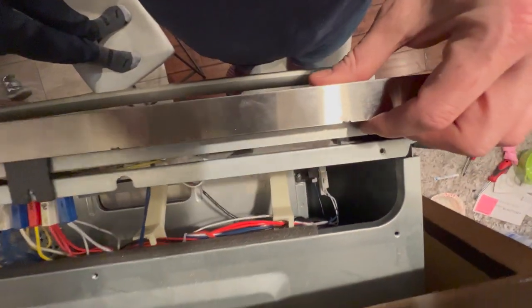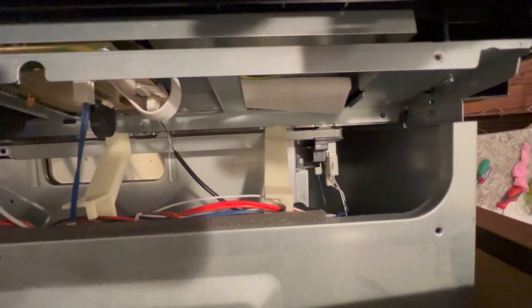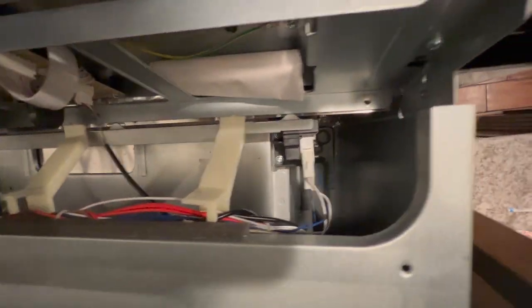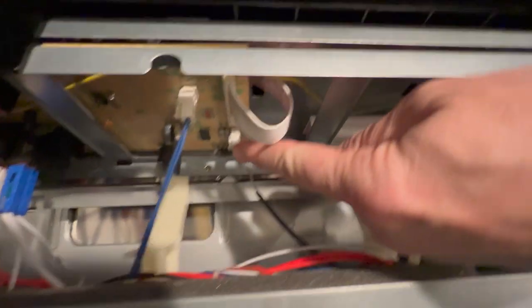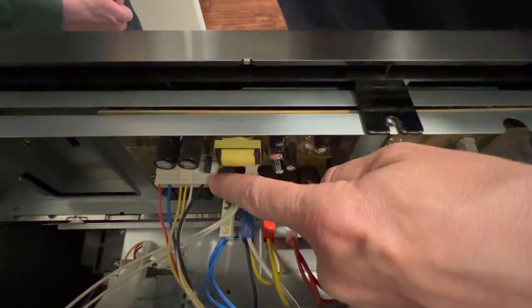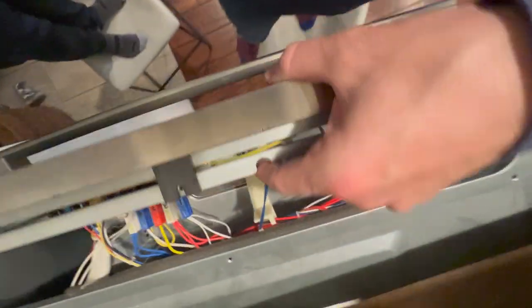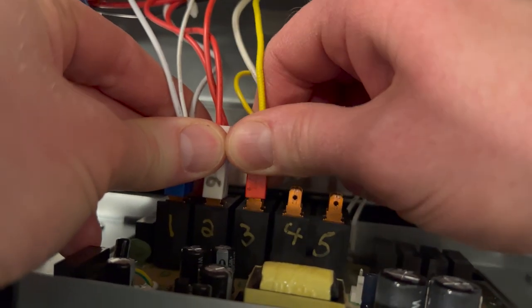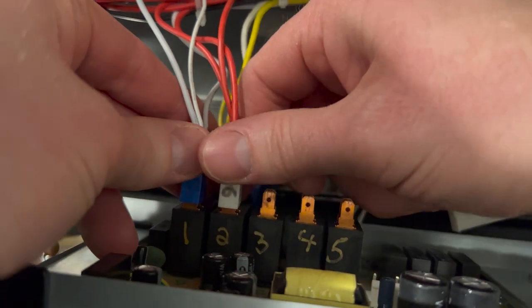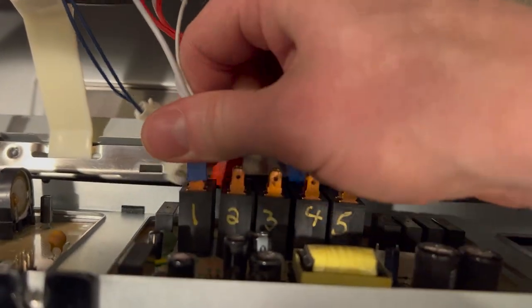If this isn't wobbling or loose yet, you're probably missing a screw so look around. Take very detailed photos and/or video of how everything is plugged in. There's a plug-in here, a plug-in here, another one right here, and then a larger plug-in right here. Next step is detaching all of these plugs and cables. To get these plugs off, they come straight off — just be gentle and wiggle them one at a time. Don't be aggressive; take your time, they pull straight up and out.